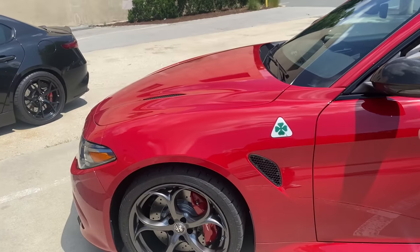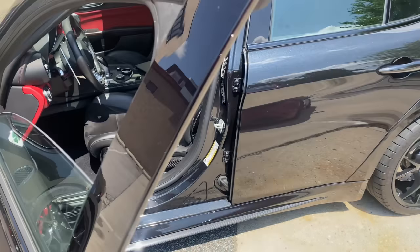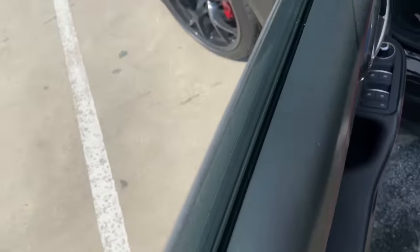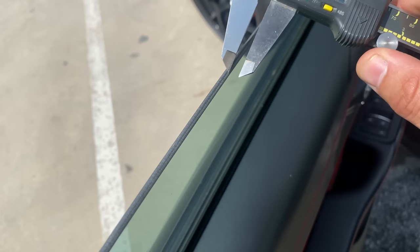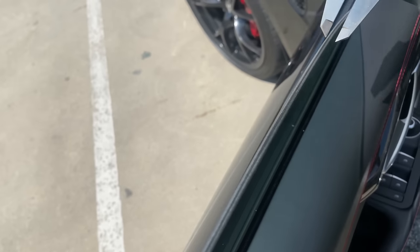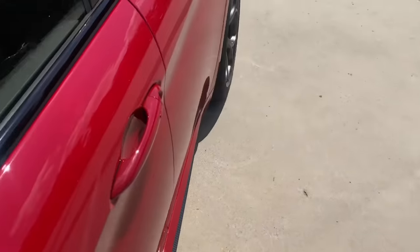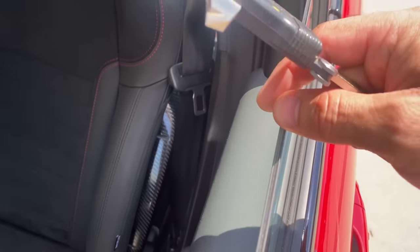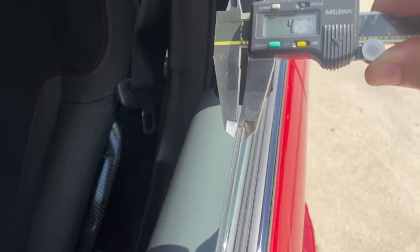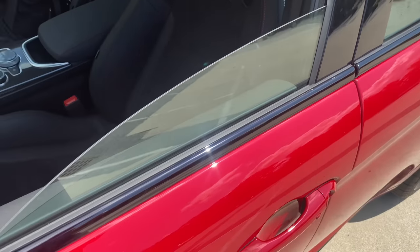One of the major improvements on the newer car is it's quieter in the cabin, much more isolated. I have my caliper right now and I already took this measurement a few days ago, so I'm going to do it again. The earlier cars have single-style glass measuring about 3.56 to 3.58 millimeters. The newer car has a little rubber membrane and measured 4.53 millimeters on the Giulia — the newer cars have much thicker glass.